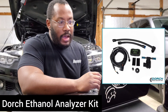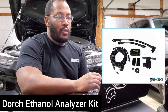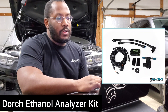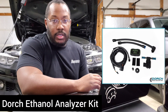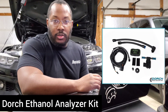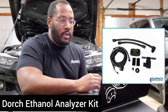They've created a couple of options for this kit because it's made for the Dorch high pressure fuel pump. So if you have one, you can use the full kit, but if you don't, you won't be able to. What they're offering instead are electronics packages — that gives you the module and the wiring harness. So if you have a Spool ECA kit or a Fuel-It ethanol analyzer kit, this will allow you to remove the Bluetooth module that comes with those, plug in their wiring harness with the CAN module, and then wire that back into the harness for the car.